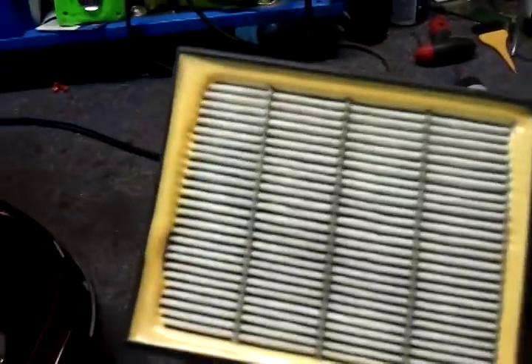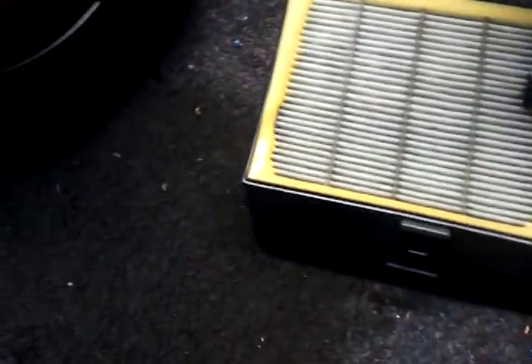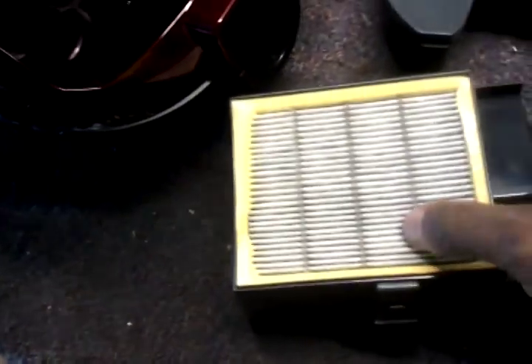There is also a little filter there that might get clogged. And there is another one which says HEPA filter F12 — lift to open. You pull that up and this is the other filter. Mostly you just give this a good clean. If you don't have compressed air or pressurized air, you can use a brush like this one here. Just give that a nice clean and probably just shake it down a bit, and that should be alright.